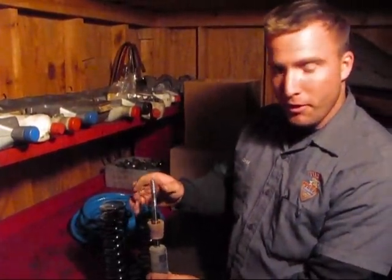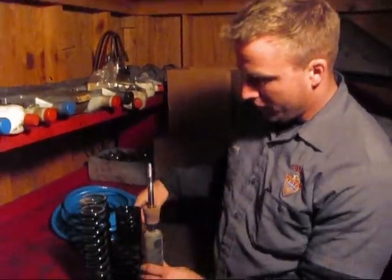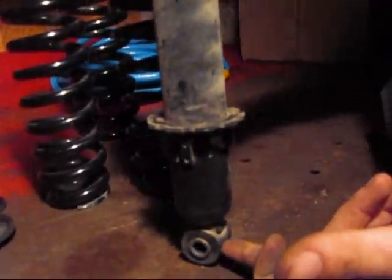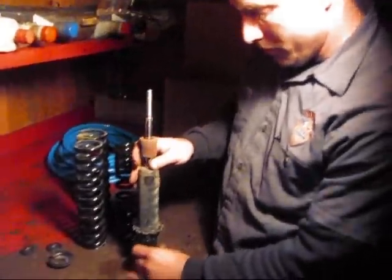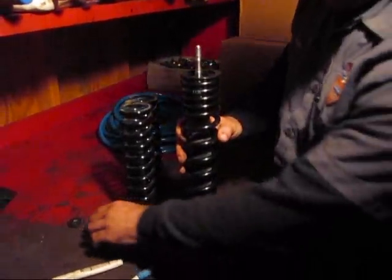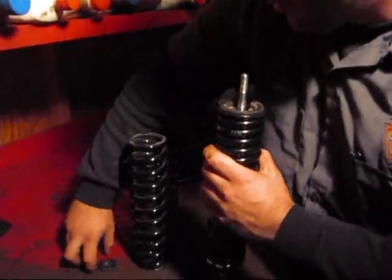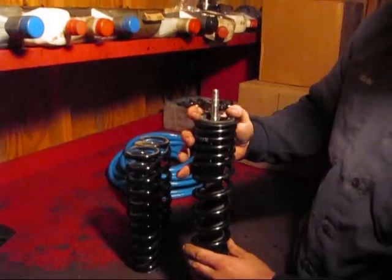So a little malfunction — we keep running out of batteries, but we've got some new ones in there. We've already lined them up. It's significantly shorter, at least noticeably. So we're going to put this on the lowest setting so it's easier to compress for us, because we basically had to stick a pry bar in there to wedge it up to get it out — unless you want to bleed the brakes, which I didn't really want to do. So we're going to stick the rising part up towards the top, just like we did on the back. You've got your keeper in right there and your two washers right here.